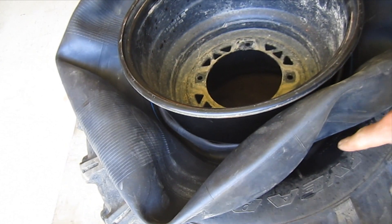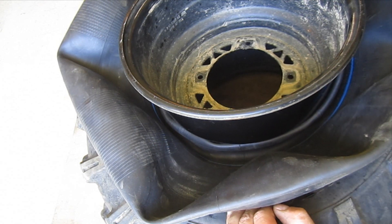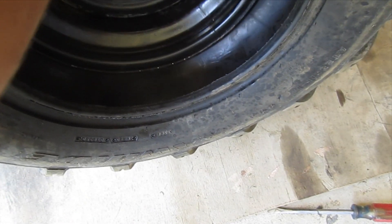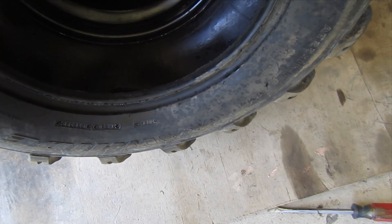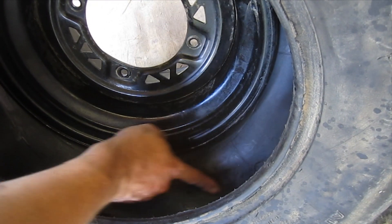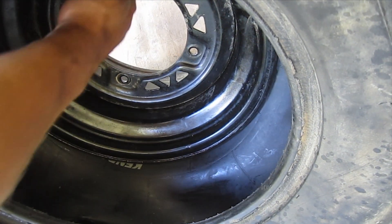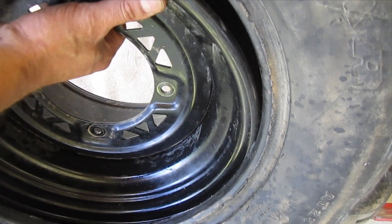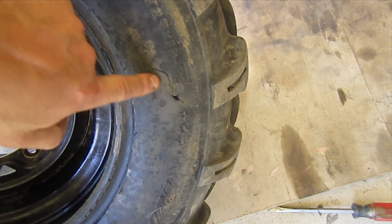Now what I need to do is tuck the tube down inside the tire very carefully. I have the tube in there and I think I'm going to inflate it a little bit and make sure there are no creases or folds. I think it's in good shape. I'm going to put a little bit more air in it, then I just need to bring this bead up, set it, inflate it, and see if it holds air. You can see the gash there now where I've been poking at it.